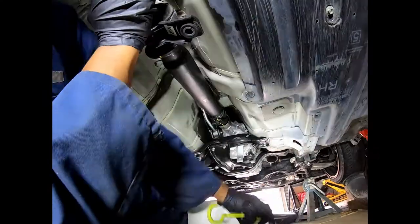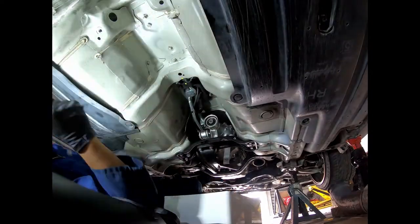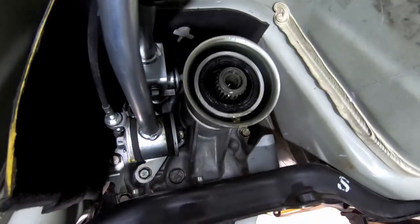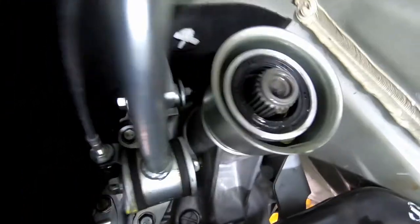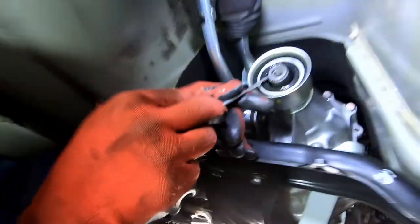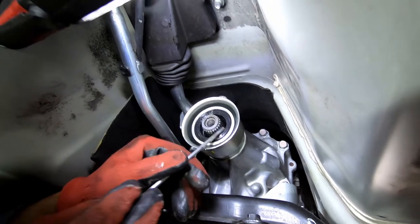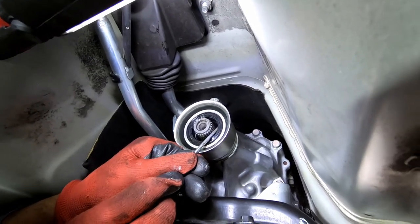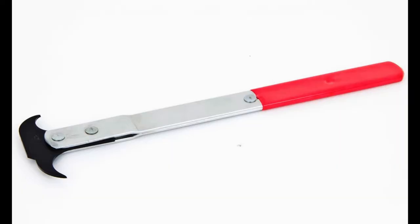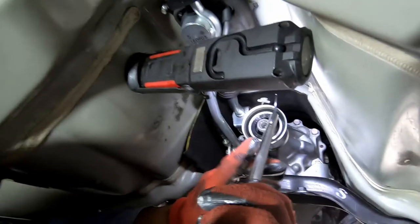Be prepared for a bit of oil that will come out from your rear output shaft of the gearbox — only a little bit, but be ready with a container. From here you now have access to the rear gearbox seal. You can use a screwdriver very carefully, ensuring you do not damage any part of the housing, the output shaft, or scratch anything. I personally prefer using a seal puller — it's a lot safer and gives you more leverage to pull the seal out in a safe manner.